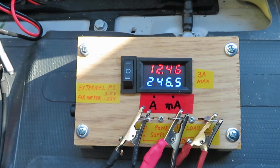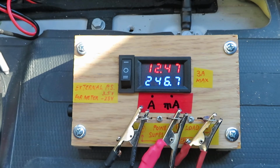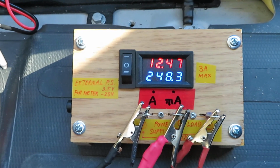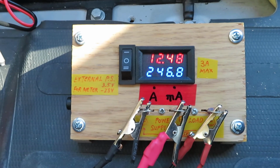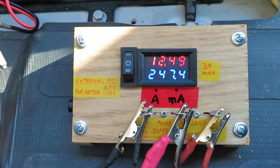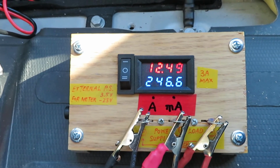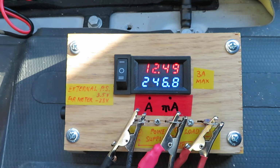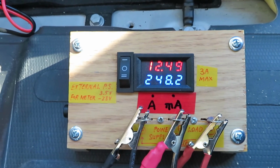By the way, I don't have any power steps because I have the power step disabled, even though the circuit is still connected. I pulled the plugs on the power step so that the drain from the power step should be minimal. If you still have your power step connected, you will see a higher drain. So the Promaster vehicle right now is still using some 240 some milliamps of electricity, and I believe eventually it would settle down to about 85 milliamps when it has a chance to finish all its lockup tasks, and I don't know what they are.